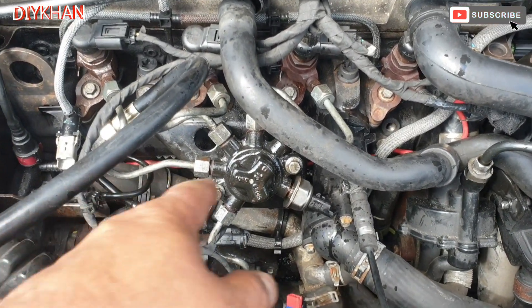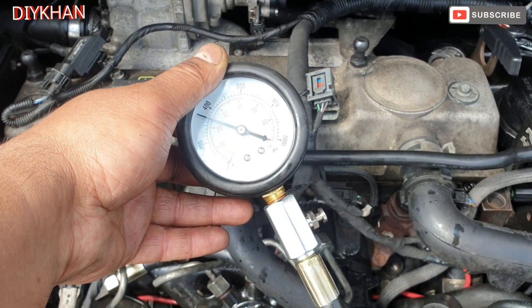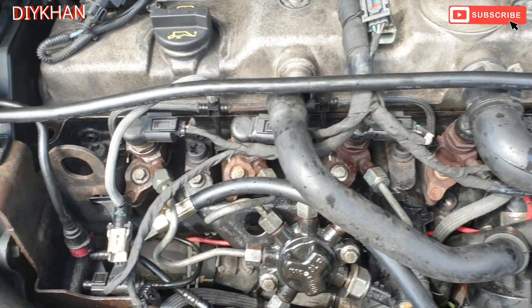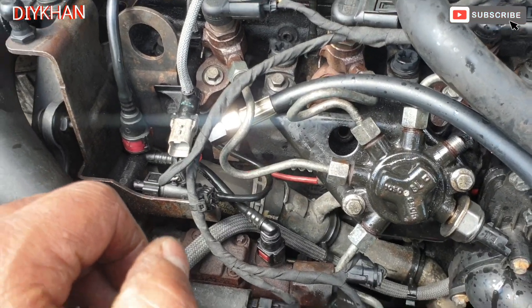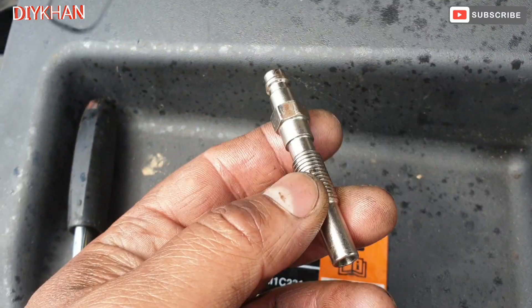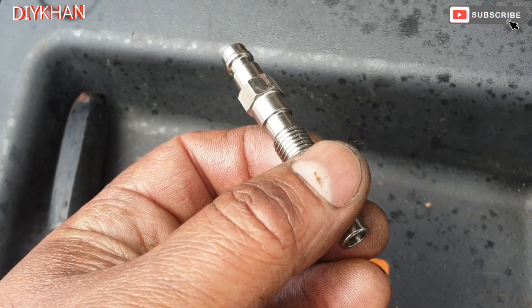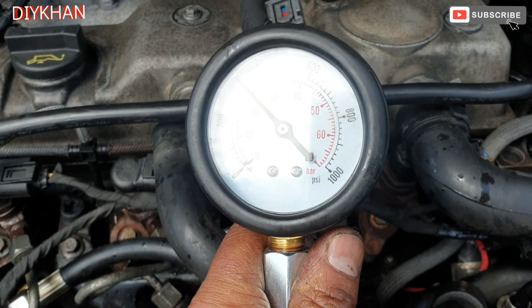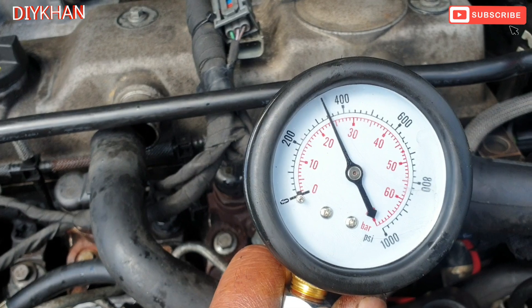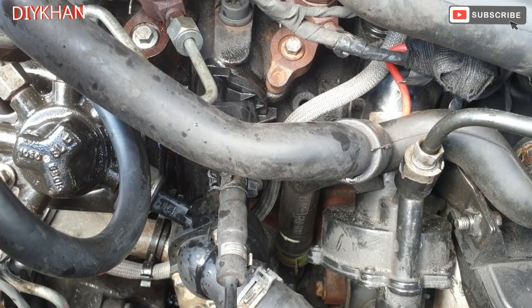The reading is around about 350 psi, which is perfectly fine. You just repeat the same procedure on all the rest of the cylinders and that gives you an idea of what the compression is like on your motor. It's a fairly easy job — you take the glow plugs off and then choose whichever connector you need, just match the thread and the size so it's the same size as your glow plug thread. I'll just show you — 350 psi — and here is the button to reset the reading.